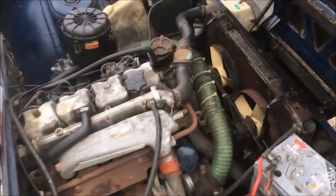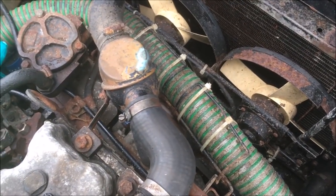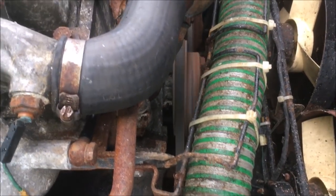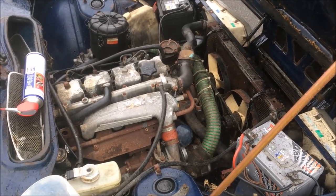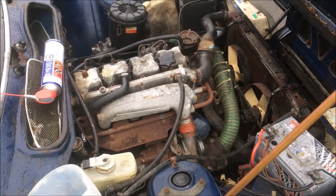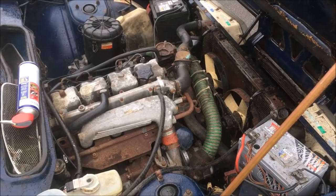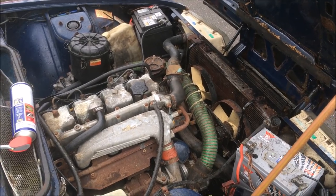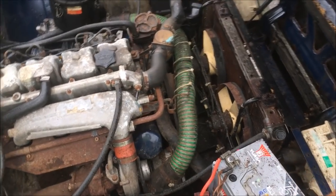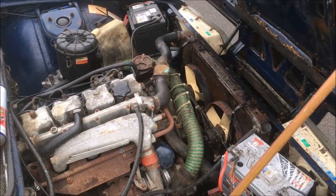Minor development — as it's been warming up you can hear a little squeaking noise, which when you rev it I can't quite tell yet whether it's the water pump or alternator. I've got another water pump which I paid 20 quid for, so what I might do instead of refilling the coolant is get it up to temperature, drain it all again, then while it's drained take the water pump off and have a look. It'll change the plan somewhat but it will allow me to diagnose what that noise is without wasting coolant twice.